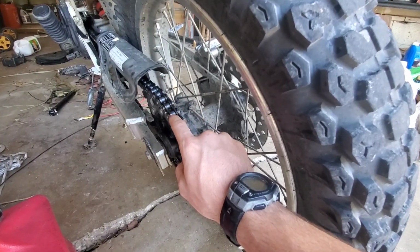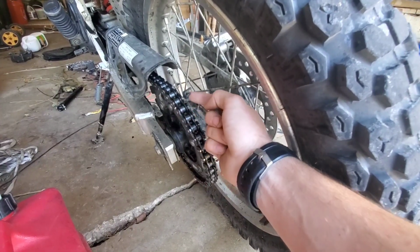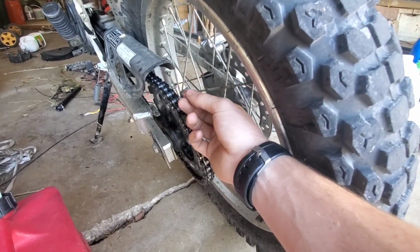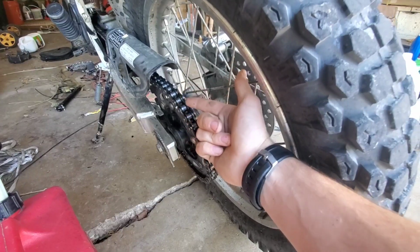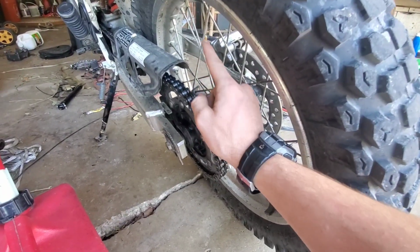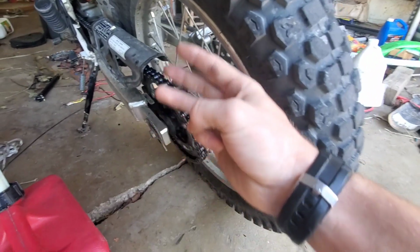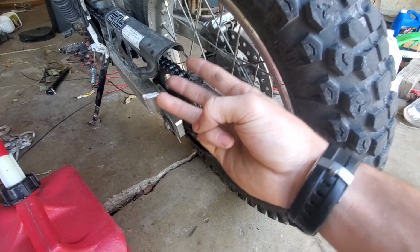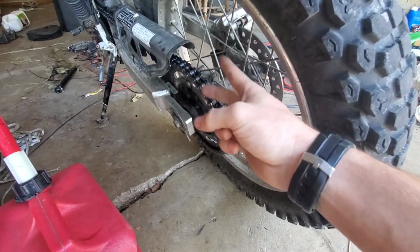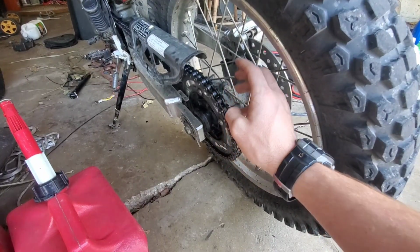Now, obviously, you can't really apply the grease itself, and you need a penetrant like the acetone, gasoline, or alcohol to allow the grease and that mixture to flow down into here. So yeah, just make yourself a mixture of 3% moly grease, high quality gear oil, and a solvent, and that is the best gear lubricant that I've ever found.